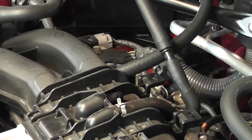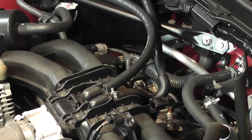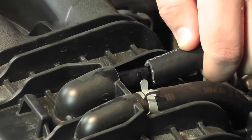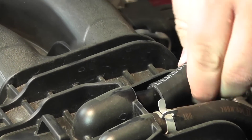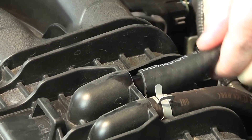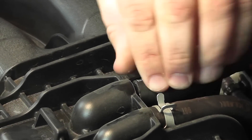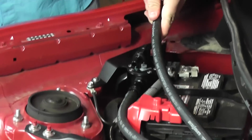You use the hose on the PCV valve already because the new hose it comes with is not the right size to fit on the little nipple down underneath there, so you have to reuse that little bit of hose. And then that hose actually fits perfect — it's a tight fit. I actually did not use any hose clamps because all the stuff is under vacuum anyways.